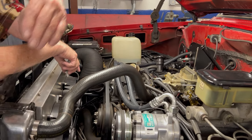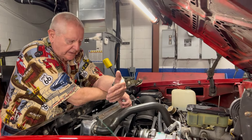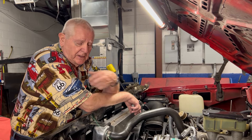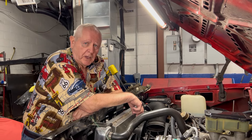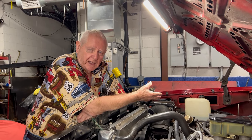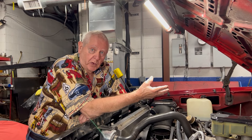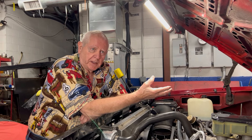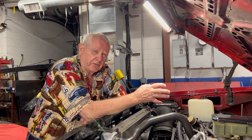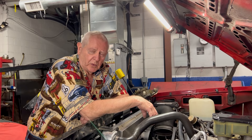When you shut the engine off, that purge valve closes and it starts absorbing fumes from the gas tank again. On all cars, if you park in the garage sometimes you'll smell gas fumes for a while. That's because the tank vents externally — mostly through the gas cap — and it takes a while for the heat-generated fumes to go away. Don't get concerned about that. But if you come back out the next morning and still smell fumes, you want to look into that. If it lasts about 15 or 20 minutes, air out your garage and you're good to go.